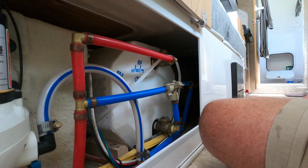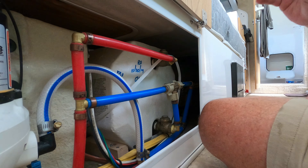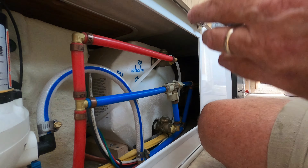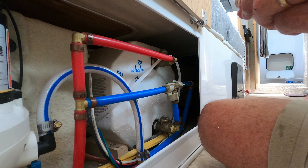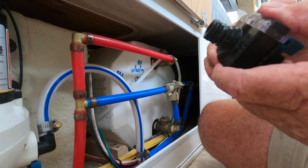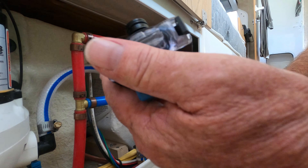You can see me pulling some garbage out of mine. I'm just going to blow it out with my breath — blow it out good and make sure it's clean. It's just a little screen to keep big debris out of the water pump. Once you've got the screen clean, just push it back in there until it latches. You'll see the two ends on the black pieces that latch up in there.